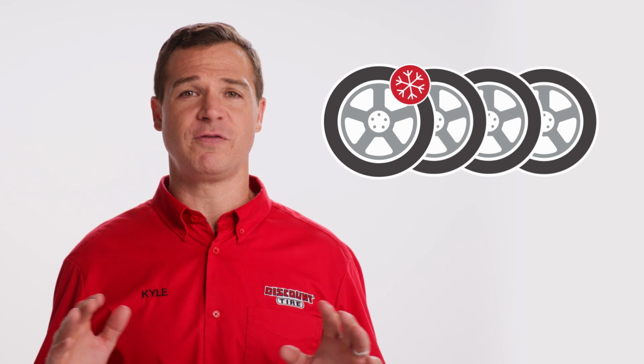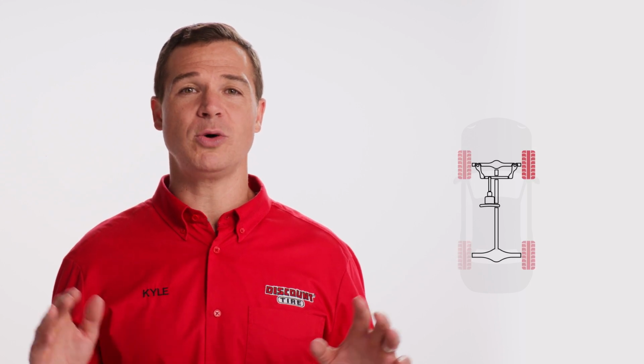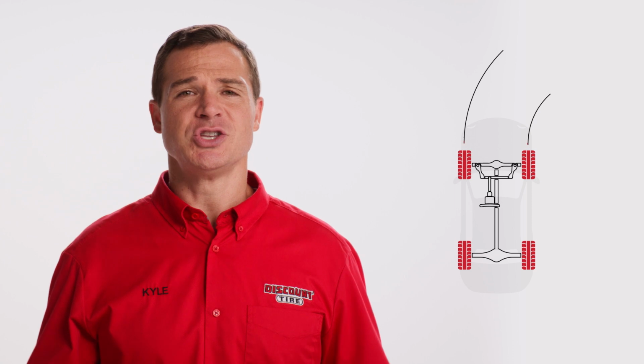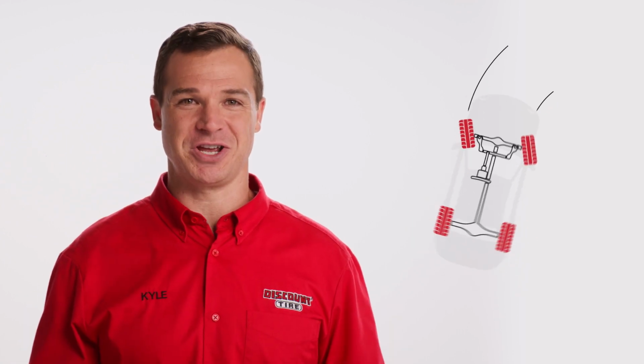Another common question we get is whether you have to install all 4 winter tires. The answer is a resounding yes. Whether you have a front, rear, or all-wheel drive vehicle, it's always best to install all 4 winter tires to reduce the risk of understeering or oversteering, also known as fishtailing.